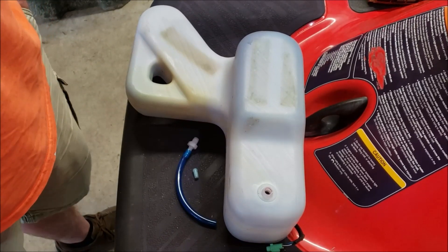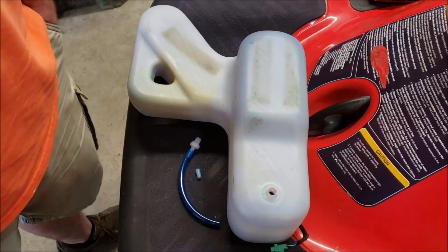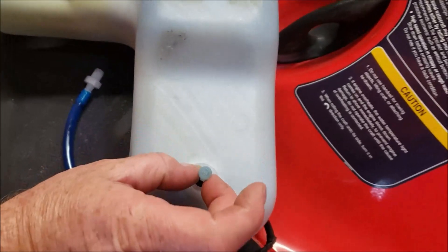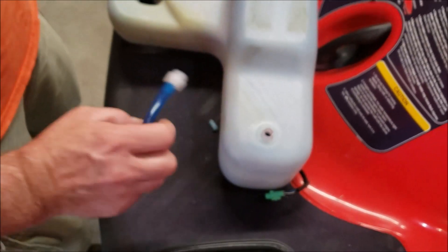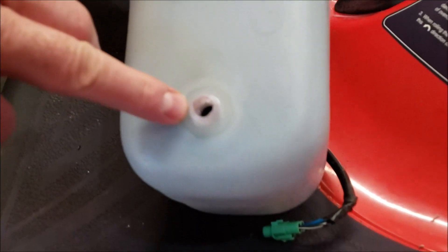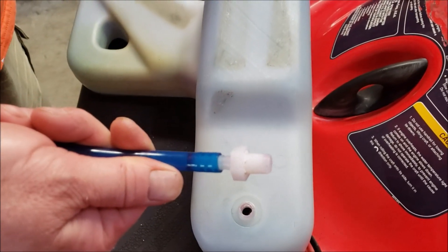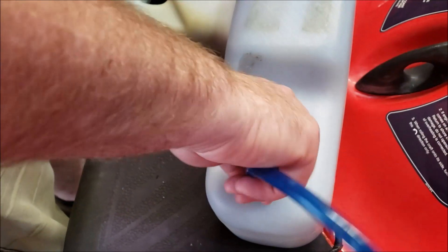The oil injection tank was leaking — not totally apparent why. We thought it was just that the bolt they were plugging the line with didn't have a good seal and so it was dripping. It turned out though that the nipple that normally sits here on the oil injection tank was cracked. There's really no way to repair that. So what we did is there's a really sizable plastic boss cast into these Ultra oil injection tanks, so we just drilled it and tapped it for a nylon fitting from the hardware store. With a little appropriate thread sealant, that's a really good repair.